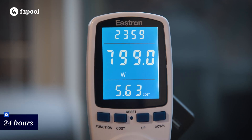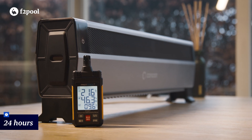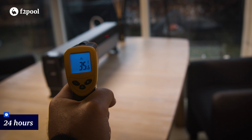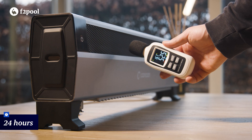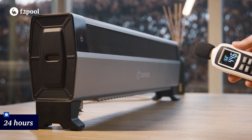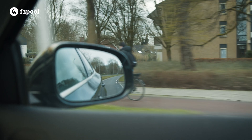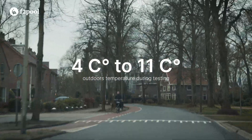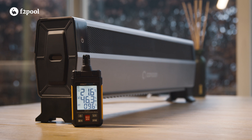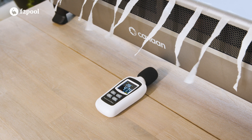At the full 24-hour mark wattage is steady around 800 watts. Room temperature has risen to 21 degrees Celsius in the immediate vicinity, device operating temperature is a steady 53 degrees, and air temperature sits between 34.3 and 36.1 degrees Celsius. Sound levels read 52.5 decibels adjacent and 44.8 decibels further away. Based on our initial tests we can confirm that the Mini 3's heating performance is more than a marketing claim — despite outside temperatures of 4 to 11 degrees Celsius and large surrounding windows, the Mini 3 created a noticeable difference in ambient temperature. And while the noise is noticeable, it is much quieter than traditional mining rigs or even most space heaters.